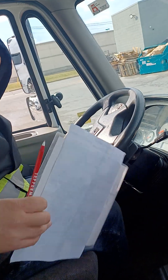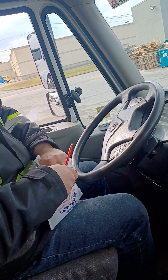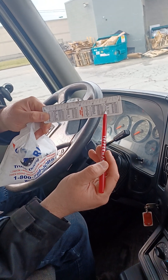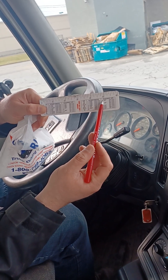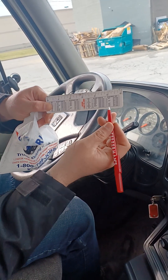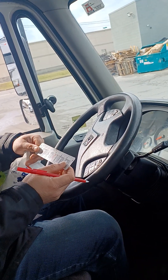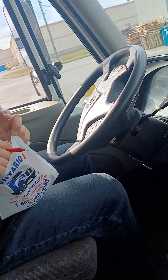You can see on this ruler here — you can get one upstairs as well — for a size 30, that's the two-inch adjustment limit. In your air brake course you probably had size 24s with an adjustment limit of an inch and three-quarters. But on that trailer back there it's a size 30 short stroke, so you're allowed a two-inch limit. When you push on that brake, it can only move out two inches — it's got to be within that two-inch limit or it would be a major defect.